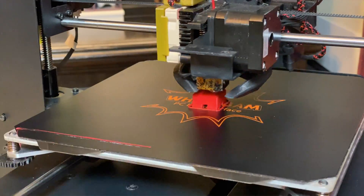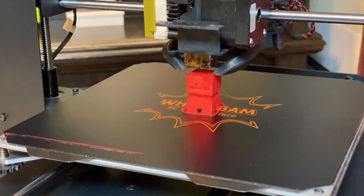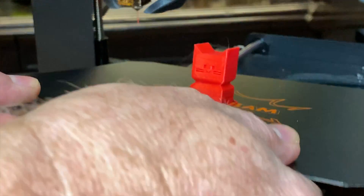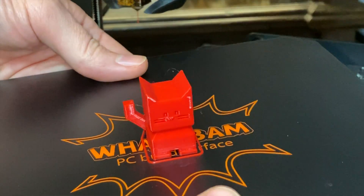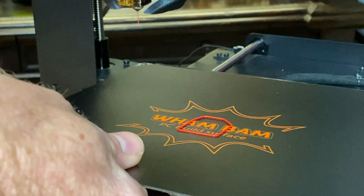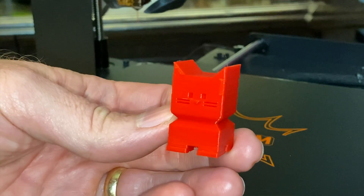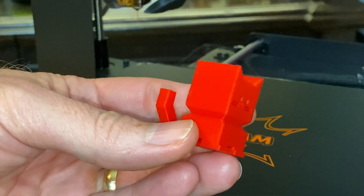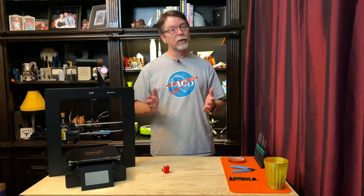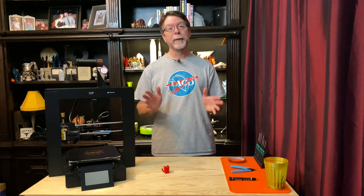So here's a quick Calicat, because it's different from a Benchy and I like to change things up a bit sometimes. The Calicat took just under an hour to print, and despite a filament break about 10 minutes into the print, it seemed to come out okay. This red PLA is an old filament sample that had been sitting out for a while, and sometimes PLA can get brittle when you don't take care of it. I'm kind of ashamed to admit this printer sat idle for a couple of months until I could get around to making this video, but now that it's done, I'm happy I can print with it again. This was my first 3D printer and I still really like it. I have a second one that needs a few upgrades, so I'll have a few more Monoprice videos coming out in the future.